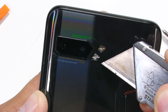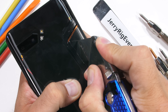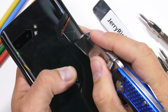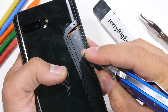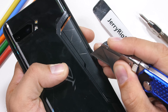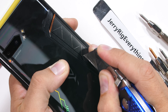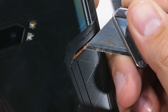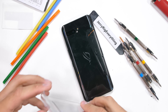The thing that makes this phone physically stand out the most is the metal grill. ASUS says the upper copper portion is a vent that lets heat escape from inside the phone, which is kind of true. We found out last year that the metal shell was mostly for aesthetics, and the copper coloring was also mostly just for looks — nothing was really wicking heat away from the processor. There were passive vents underneath the metal of course, but no internal fans. The actual heat pipe — the part that keeps the phone coolest — is on the screen side, not the back panel. We'll see if that's the case when we tear this down as well.